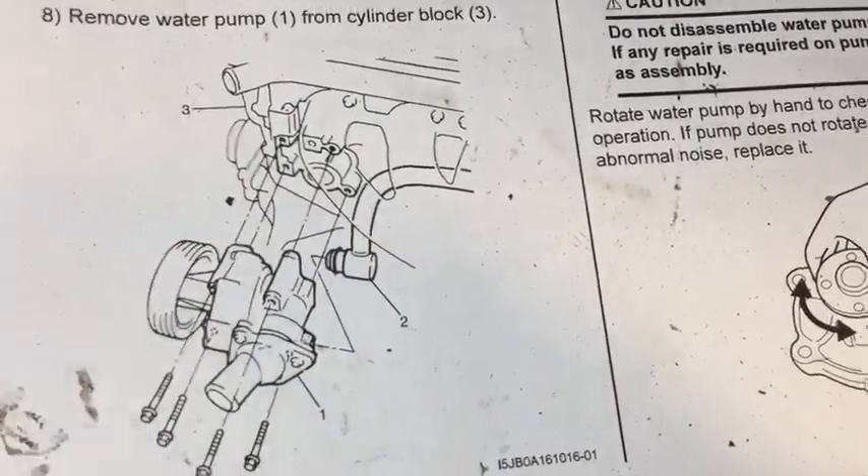I've got a green pad and some WD-40. Probably one of the most important parts of this job is actually getting the face of the pump clean. You can see right here — getting this flange clean, WD-40 it up, keep scouring away gently until you get it as pristine as possible. If there is any residual silicone or sealer left on there from the last application it could cause grief, and this is a lot of grief — you do not want to have to do this a second time because it's leaking.